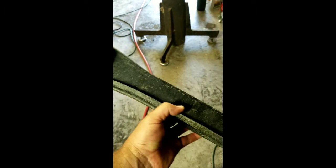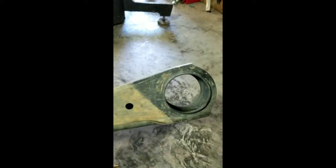I replaced the bushings on the lower control arms about two years ago, and I've been getting some rattling in the front end. The other day I found my driver's side lower control arm bushings had actually backed out — they weren't seated in there. This is the original control arm, so either those bushings are incorrect, or the bores on these control arms are just worn out.